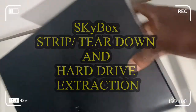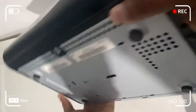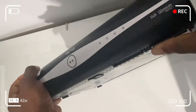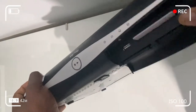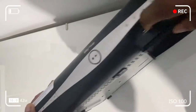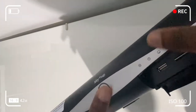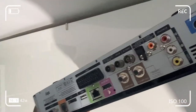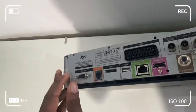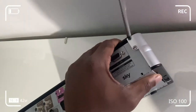The main aim of this video is to perform a full strip or teardown of the Sky HD box, hopefully with the intention of salvaging or retrieving the hard drive. Here you can see the viewing card in the slot. The construction of the box is pretty basic. You've got the play buttons, stop buttons, the luminous play button, used for recording catch-up programs. At the back you've got your SCART, audio, video, HDMI, PC interface, Ethernet, antenna and satellite port. I'm going to take out the two screws from the back of the box.